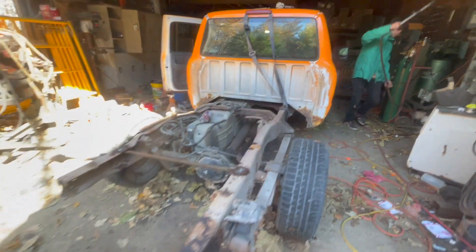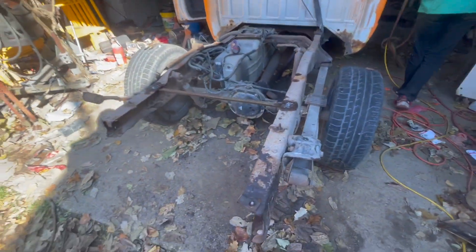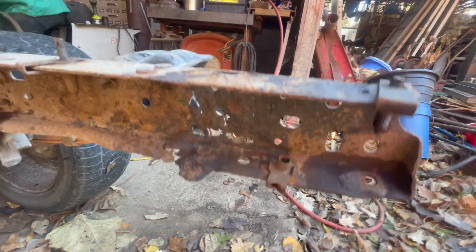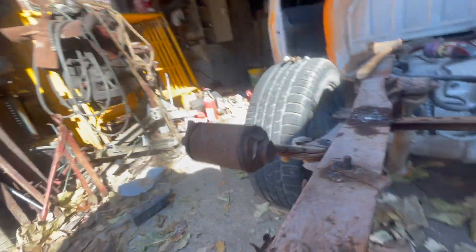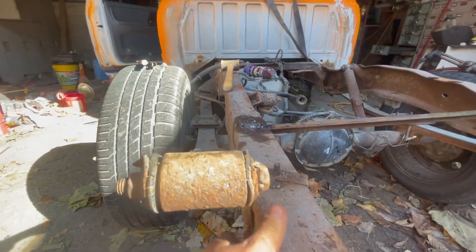Eliminate any opportunity that he has to hurt somebody. Okay guys, we got Sam. He's getting ready to torch this frame rail off. So you can see this — they're not even. He's going to make it even with what was there. It's pretty rusted through good there, as you can see. So we're going to cut it about right here. Plate it to brace for this. Then this side — this one's rusted out, gone. We're going to order the new thing, bolt that back in there and plate this side up.